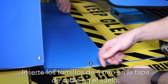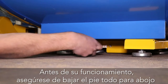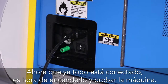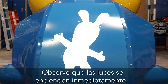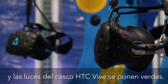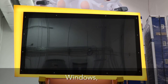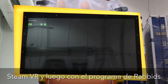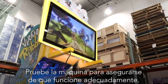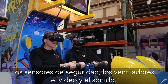Next, test fit the floor cable cover and make any alignment adjustments needed before tightening the 10 millimeter bolts to secure the skis. Insert the 4 millimeter screws into the floor cable cover, making sure not to tighten any screws until all are inserted. Before operation, be sure to lower the feet all the way down on the front sled to reduce any movement or vibration. Now that everything's connected, it's time to power up and test the ride. Notice that the lights come on immediately. The motion base performs a range test and the HTC Vive headset lights turn green. The top monitor boots with BIOS, Windows, SteamVR loads, and then the Rabbids program. Test out the ride to ensure proper performance by paying attention to all movement, lights, headset functionality, safety sensors, fans, video, and sound.